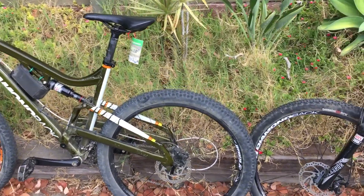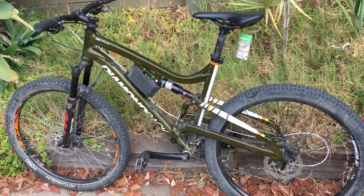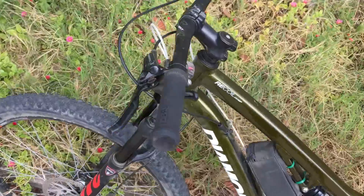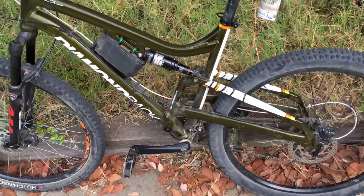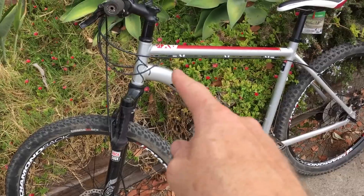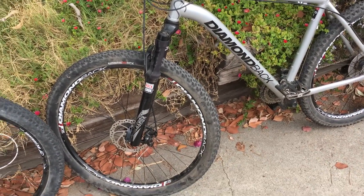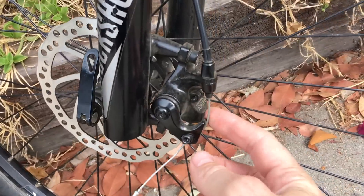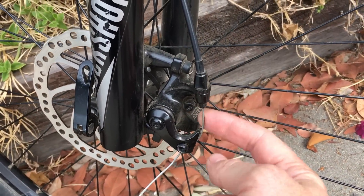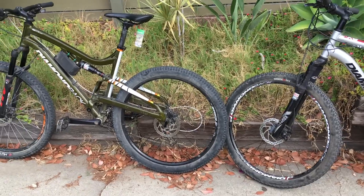The reason people say to go hydraulic is that it requires less lever effort. Hydraulics are a sealed system, so dirt can't get in and gum it up — whereas on a cable, dirt can get in and jam it. All the moving parts are outside on a cable system, so if you rode through mud you'd get mud in there. Some of your decision is going to be based on where you ride and how dirty you get.